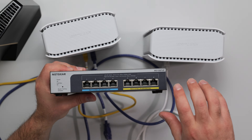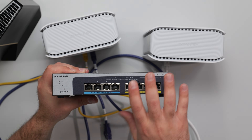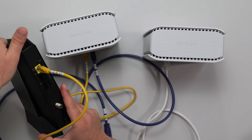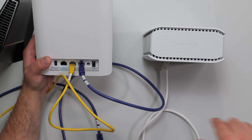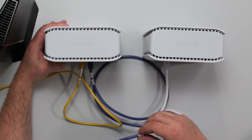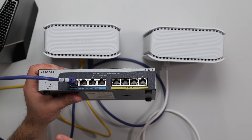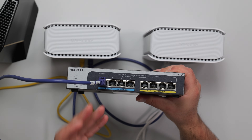I'm using a managed switch that supports Power over Ethernet and up to 2.5-gigabit speeds for the demo, but you can use it just like an unmanaged one. Assuming internet speeds of 2 gigabits, connect from the 10-gig port on the router to the switch — not from the gigabit port, or speeds will be capped. Connect the Ethernet into any port on the switch; with an unmanaged switch, the port doesn't matter — the switch automatically figures out the source. I like to use the first or last port just to remember which is the internet source, but it's not required.